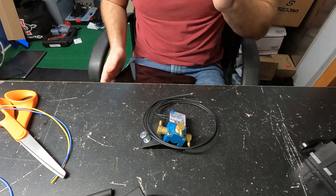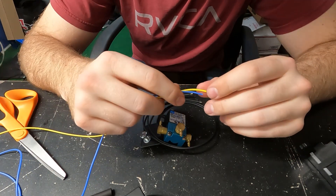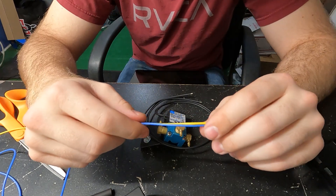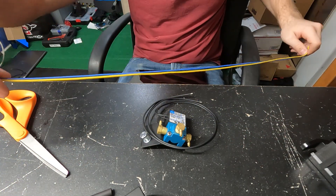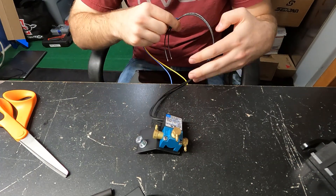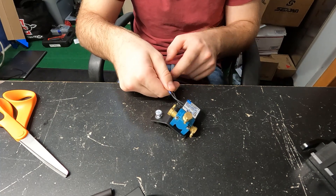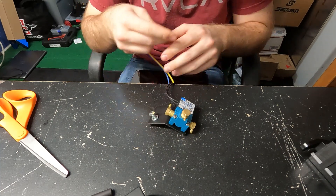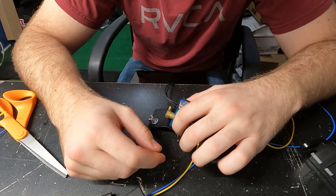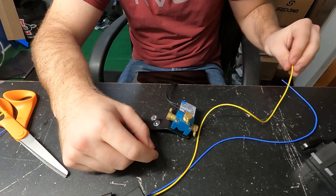So that's how it's going to work with the two-stage system: stage one or low boost is switch off, and high boost is switch on. I've got a blue and yellow wire here, and I'm going to put terminals on them to plug into the relay box at the corresponding pins. I'm going to leave the other ends without a terminal for now because I need to figure out what wire length I want, and I'll splice one end in and run the other straight into the pigtail connector to keep things clean.